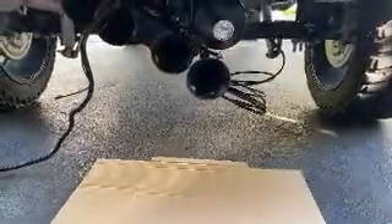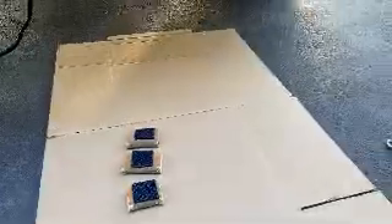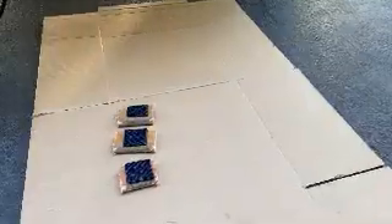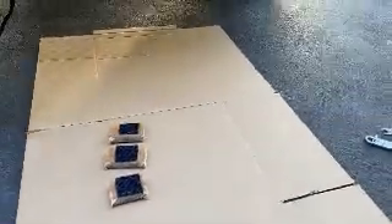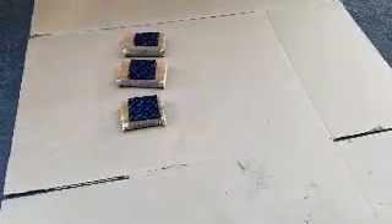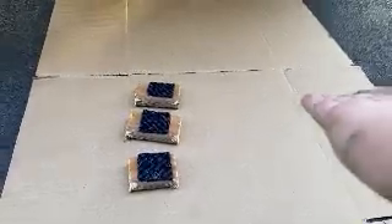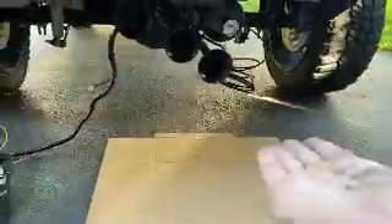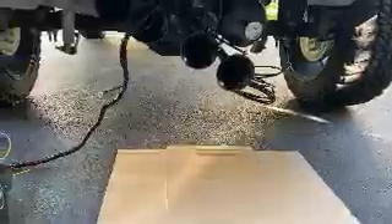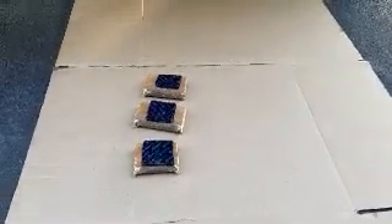So we're going to make some adjustments and then come back. So just to update you on the Hornblaster kit — I've got it hanging down right now. What I found was it has about this much of a gap between the feet and the top of the frame. Hornblaster has recommended you get a bigger piece of thread that fits up higher. But being innovative, what I've done is I've cut four pieces of wood. The reason there's Velcro on them is because you put the wood up there and it's going to fall out. The Velcro is just an easy cheat way of putting it where you want it on the frame, and it'll hold itself up there. So once that's up there, I can lift up the Hornblaster and it will attach to those pieces of wood, and then I can tighten it really good — because you don't want to rely on just the cable. You want to make sure those four feet are making contact with something.